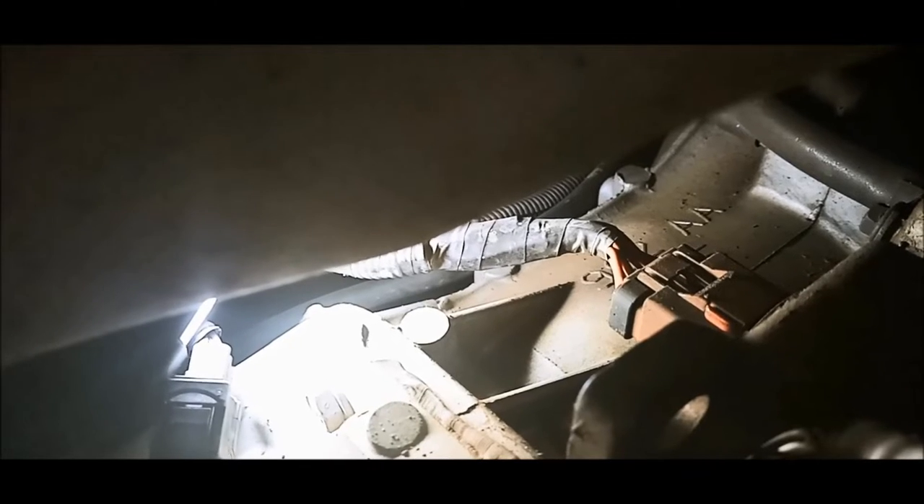So that's the right hand plug. You can see you have to take out that little red locking tab before you can press that to pull the plug out. Make sure you blow it all out before you pull it out too. I've just tapped it out and there's the little locking pin — the little red one. That one was just pushed in from the rear forward, so you can just get your screwdriver and hook it onto that and tap it out. Now you'll be able to press that little tang and pull the plug out. It's got very confined space, so apologies for not being able to film it properly.